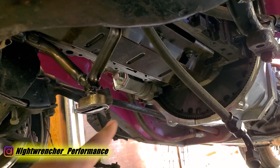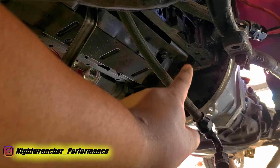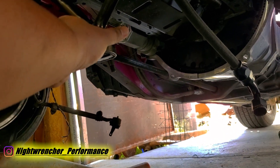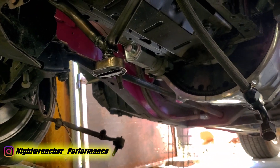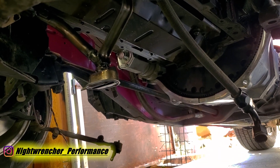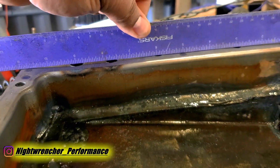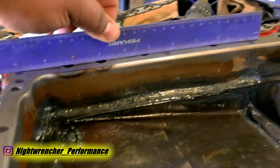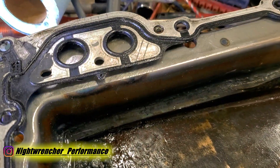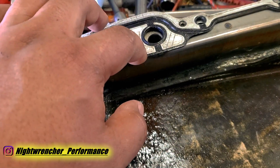Here's the custom pickup I built in a prior video. If you look closely there are two holes on the right side. In the LS, the oil goes up through the front, through the back, through the oil pan into the filter, and then back into the engine. To test this I pulled the oil pan, grabbed a quart of oil in a cup, and put it right on the pickup tube. As soon as I used my priming tool I had a grip of oil coming out where it's supposed to, and the quart was draining really fast — meaning the oil pump was doing what it's supposed to. The problem was it wasn't building pressure. You can see there's still a slight gap between the flange and a straight edge, and the oil pan gasket was being pressed on three sides but had no tension on the fourth side — nothing holding it up against the block.